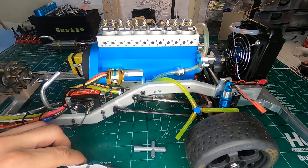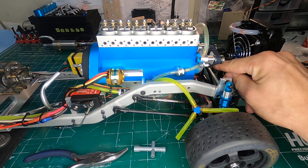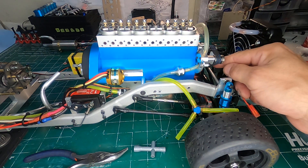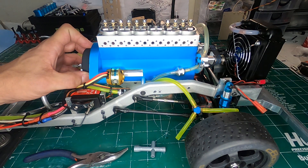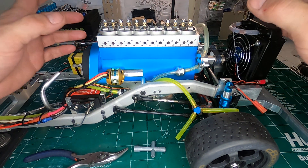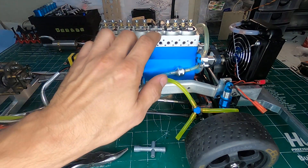And that's all you need. Now, what I've gone and done is I've marked out my crankshaft so that I have marked each cylinder out at TDC. So all I have to do is rotate the crankshaft to that mark, and then I know that I'm at TDC for whichever cylinder I'm working on. I do two cylinders at a time, and right now I'm working on the middle two cylinders.